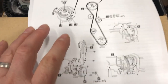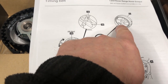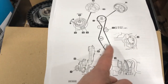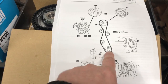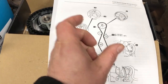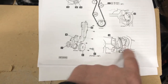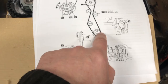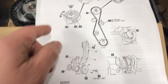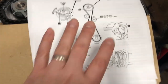The basic outline of the belt and tensioner is quite simple on these. You've got a locking pin - you can use a 6mm drill bit - in a hole in the camshaft pulley at the top. At the bottom you've got a keyway but it's slotted in the actual sprocket. There's a slot in the sprocket which you have to make sure is in the centre because it can go either way. There's also a locking tool for the crankshaft, though I'm not going to use that - it's just to stop the bottom end moving.